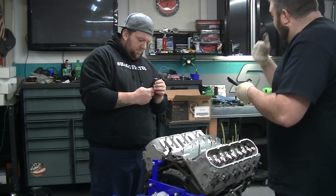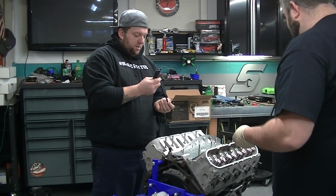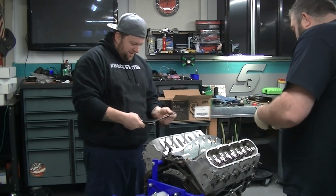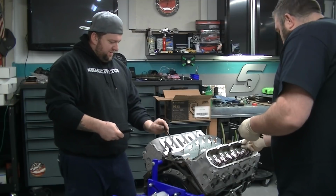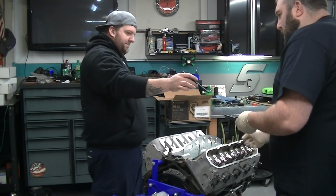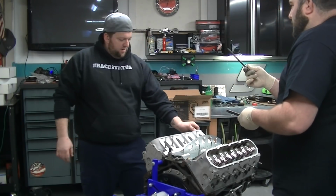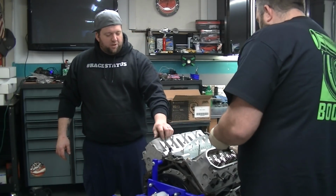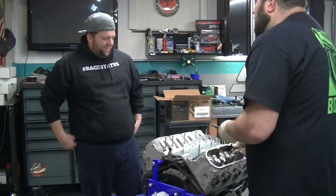So, I'm actually going to buy a set of push rods. Really? That's amazing. The 740s, I got a set. I figured the built motor should have push rods. You should be putting bigger push rods in it. What's the next step up from these? These are 5/16. It's going to go to 3/8. Oh god, I just pushed down all the lifters.